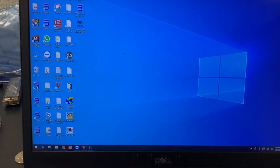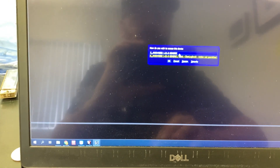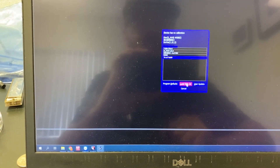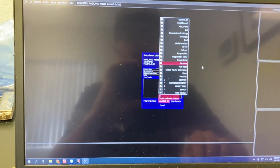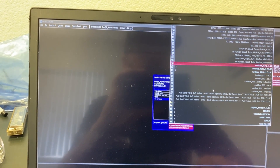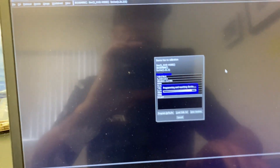Now we're going to open a program called SCAL. In SCAL, go to Device > Connect, which will bring you to the generic view. There won't be any calibration on it after you do an ENC update, so go into Load Disk Cal and find the base map or whatever map someone's given you. For now we're just using the base map since that's how most people get access to it. Go to downloads, find the base map you just pulled off the website, and it'll open up like this.